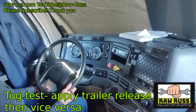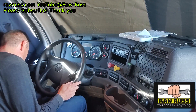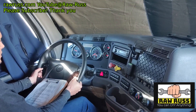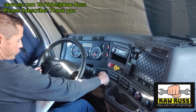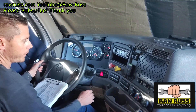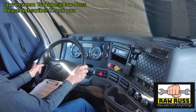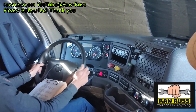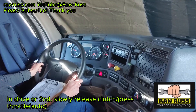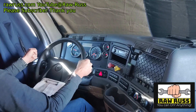Now I'm going to perform my tug test. I'll take the key with me, go remove the chocks with the brakes engaged, then start the engine back up, perform a safe start, and let the air build back up. I'm going to release the tractor brake and pull out the trailer brake to do a tug test and see if it halts. I'll put the vehicle in drive or second — a low gear — because first or low could overcome the brakes. I'll slowly push on the throttle until I feel a tug indicating the brakes work properly. Tug — good test.